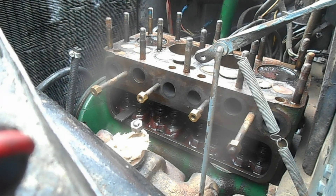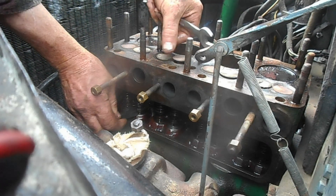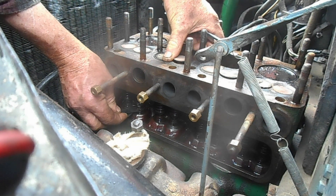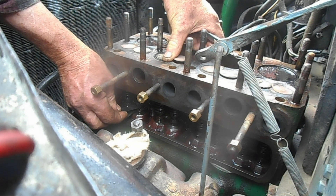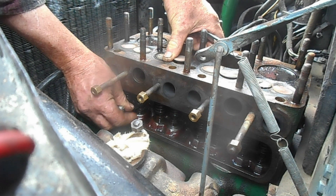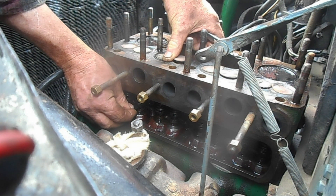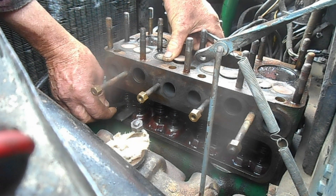Now with this, you've got the bucket here and then the locking nut and then the adjustment bolt. You just put the feeler gauge in just above the adjustment bolt and it should just be a sliding fit.